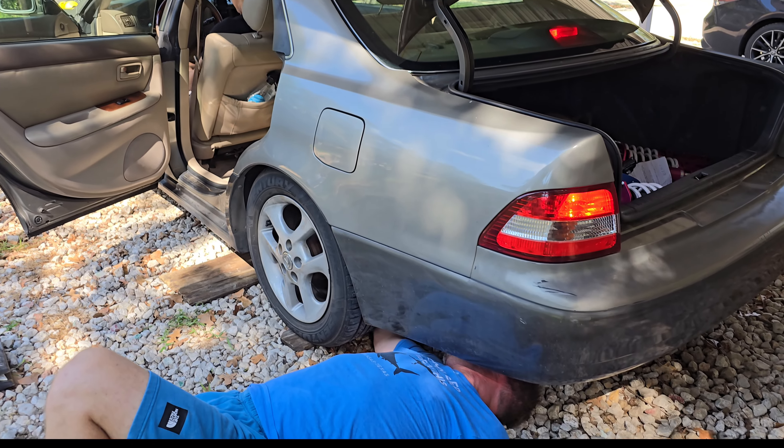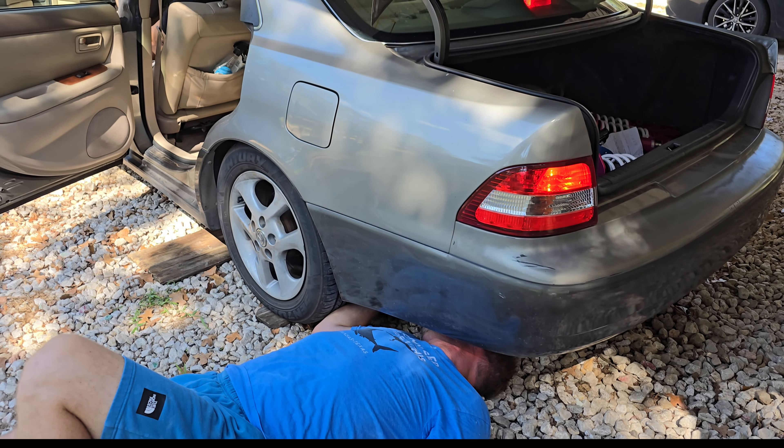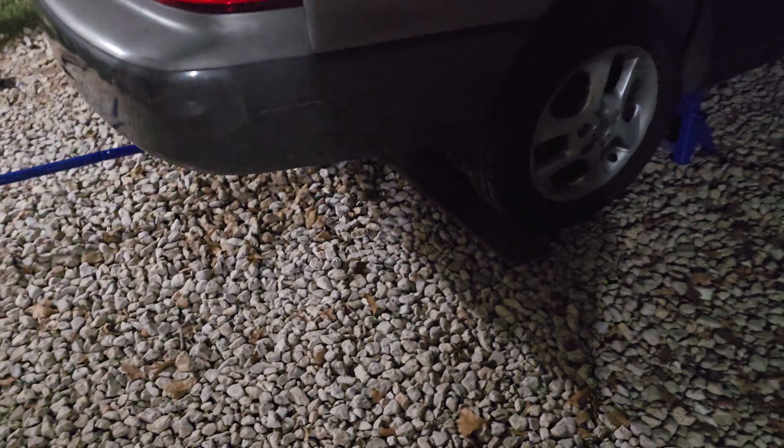At this point I decided the school shop would be best, which I should have assumed beforehand. But we also had a bigger problem because my brake system was an ABS brake system, and we really screwed up when we bled the brakes. We actually had to have somebody bleed the ABS module, proportioning valve, all that — and it was a nightmare that ended up actually costing me money. Great job, past Wyatt.